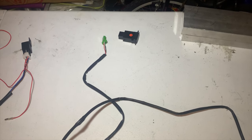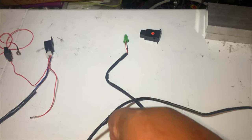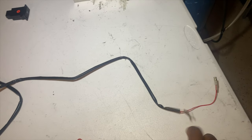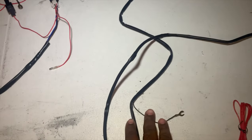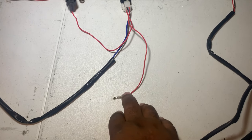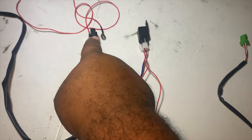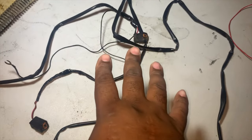So you can play it back and recap if you need to. We got switch — that plugs into the switch, that turns on and off power to here as soon as it receives it from the ignition switch. Extension just in case it doesn't reach. Ground along the way. Our relay — and this is what is turning on and off the relay. Then this gives the relay constant power, which is fused. And this part, on the back end, goes to the actual fog light to turn it on and off. So we're going to start with the inside and work our way out.